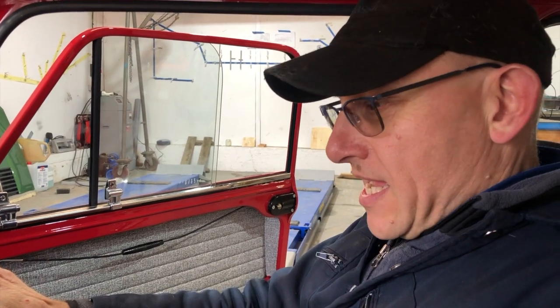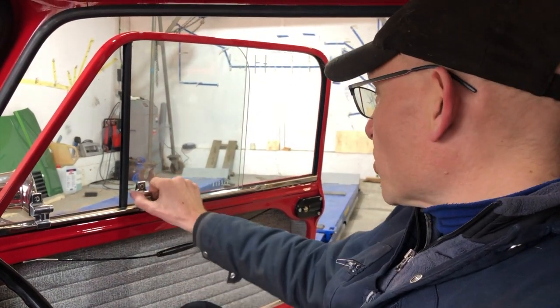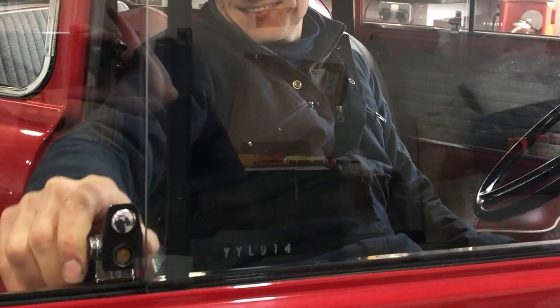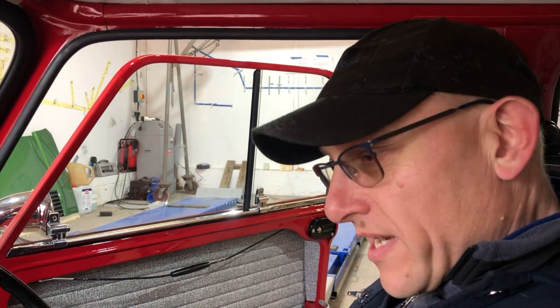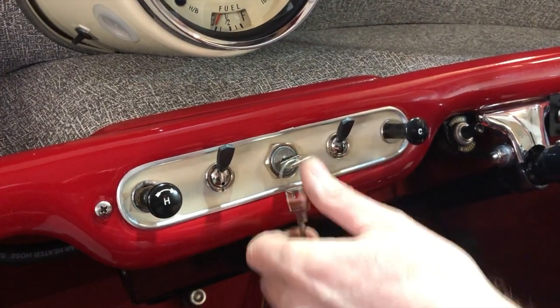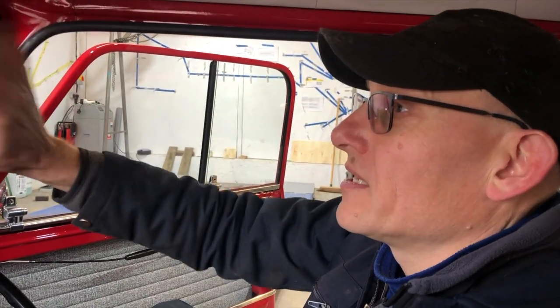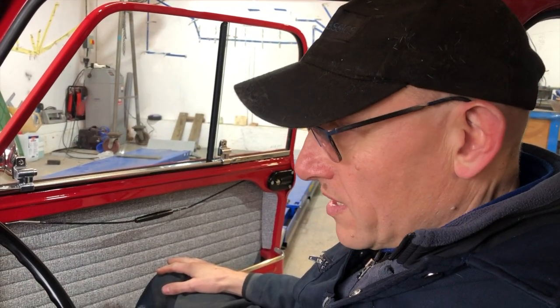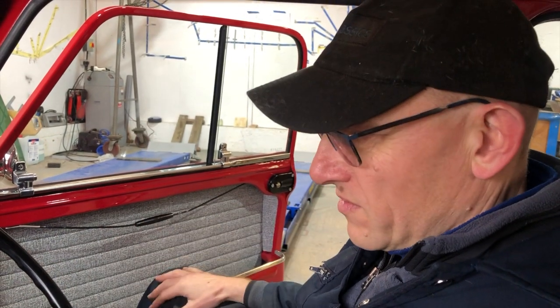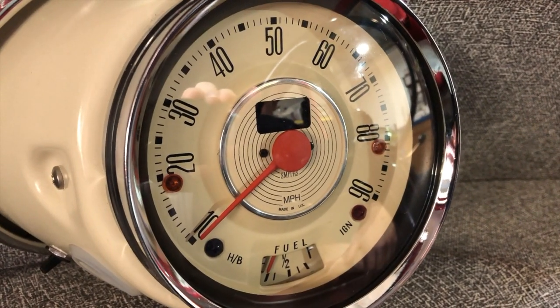Here's the inside of the car — very, very standard MINI. Look at this: the door pull for opening, a bit squeaky, needs a bit of oil. It's got sliding windows — how cool is that? From our point of view of controlling the electrics, it's very much the same as what we've done in other cars. We'll end up turning it on and pushing the starter — the starter button's down here on the floor, which is really cool. We're going to have a digital display in the car. We haven't quite agreed where to put it: there was talk about putting it on the flat, on the sun visor, or maybe just around here somewhere — but trying to keep it looking as original as possible. It has got a modern speedo in there, which we'll drive from the CAN system, along with using the fuel gauge to show state of charge.